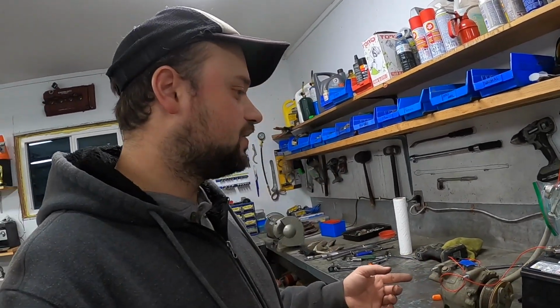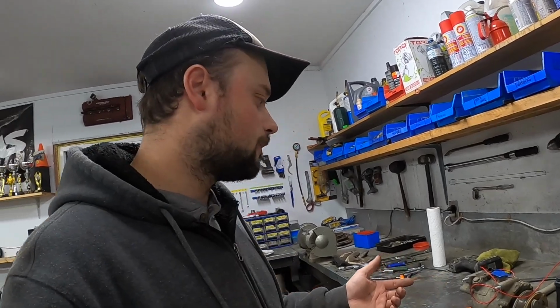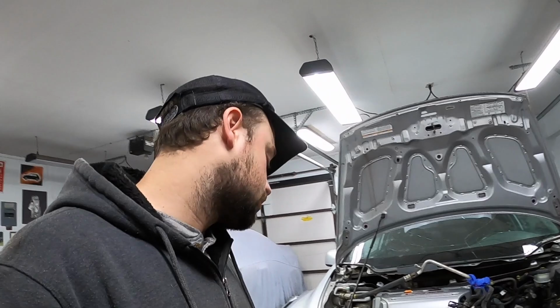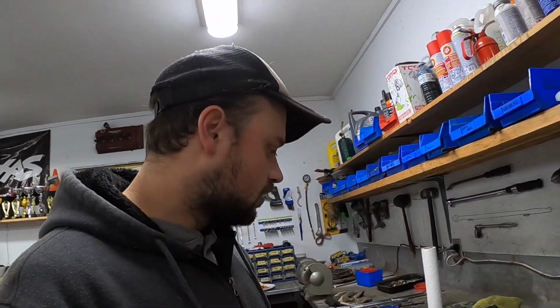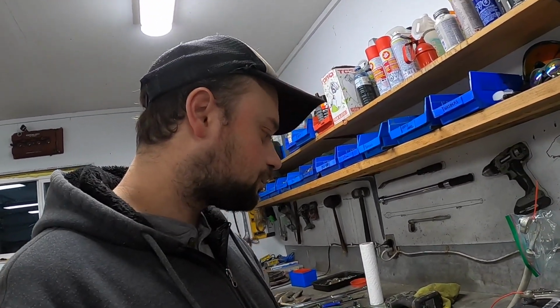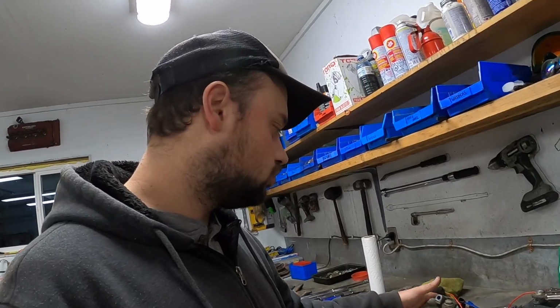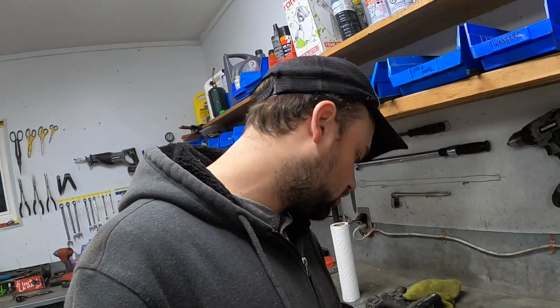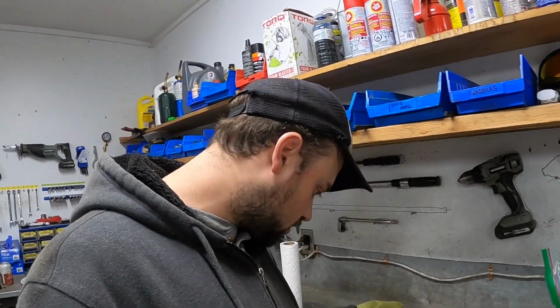All right, the AC is an unknown for me on this car. I just know that it did not work. I do not know why it didn't work. When I took the car apart, it had no charge, so that's probably thing number one. But I want to check it here and see if the clutch is engaging on it.